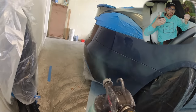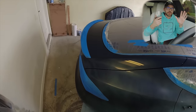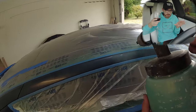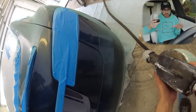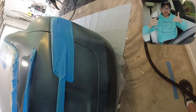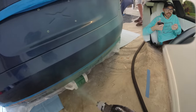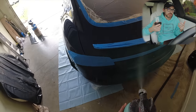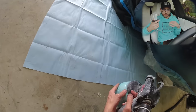The closer you get, the thicker the paint becomes and the shinier the layer. In the first layers it's important to get dusting coverage over the entire car. Don't worry about spots - you can see obvious missed areas but it doesn't matter; we're going to do a lot of coats total. Here you can see the role of a second person: pulling that large compressor cable away from the car, because as you walk around it the cable inevitably tries to tangle and touch the bumper or fender.